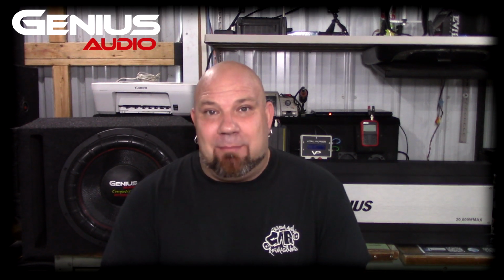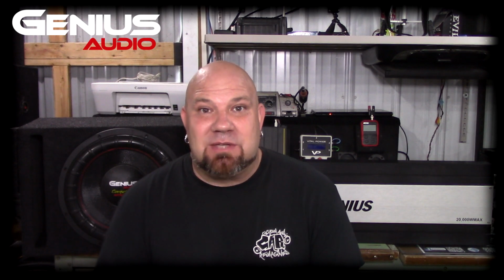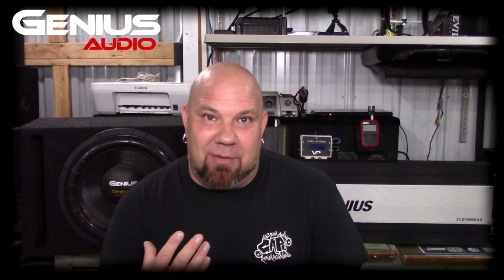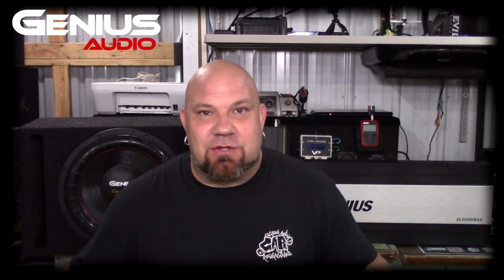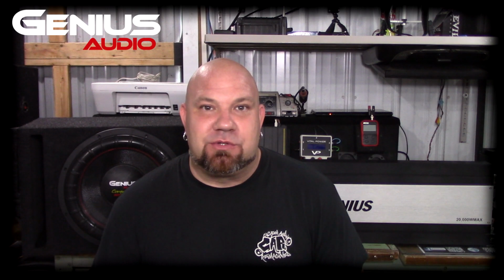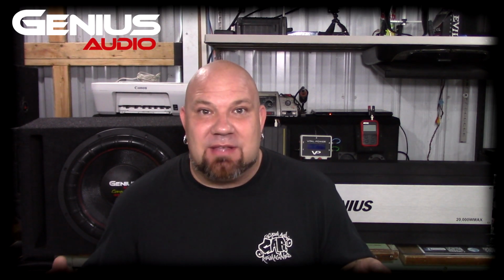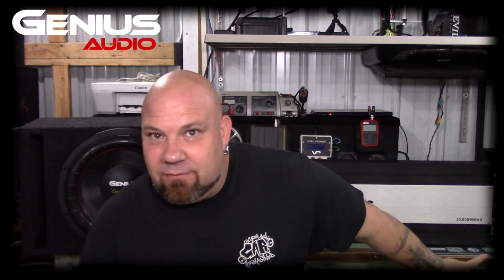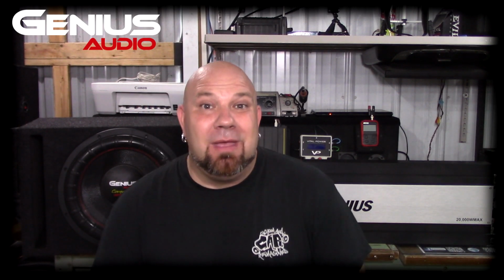There are a few things about the amp that you do need to know as a consumer if you're gonna buy it. One thing is, it does have fans on the bottom of it. So you cannot mount this thing straight to carpet or straight to a wall or straight to wood, because you're gonna get no circulation. You're gonna need to elevate this amplifier so that air can circulate underneath it. All the airflow is gonna run underneath the bottom of the amp.